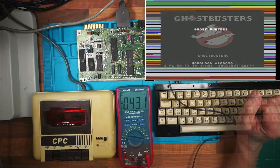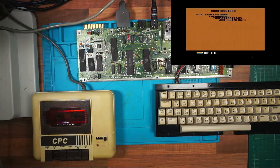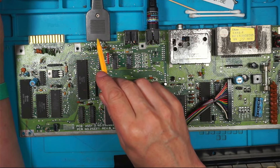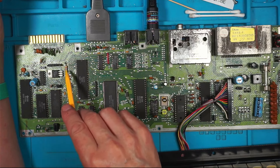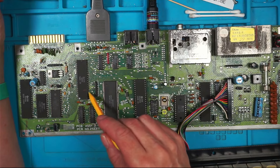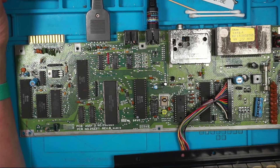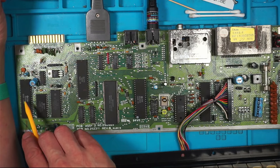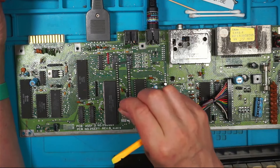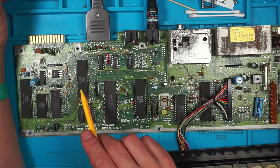As you can see the game has loaded okay - probably need a keyboard and a joystick. Now the problem is I don't know where the fault lies, because I can follow the six volts from here and it goes to resistor one, Q1, resistor three, Q2, and then to pin 24 on the CPU. It all works, there are no shorts because obviously the game's loaded. It's been recommended I change the CIA chips - swap them around - and I've bought some sockets to do that. Or it could be a problem with the CPU itself, which I think is about £25, or it could be a problem with the tape deck.